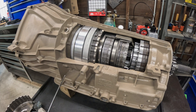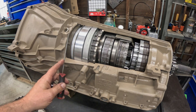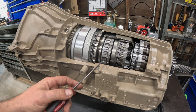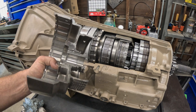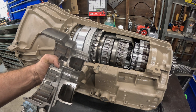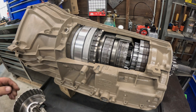There's no magic in here, by the way — I'm not giving away any secrets. This is a fully stock build with used frictions and used steels. The forward drum has stripped splines just like this one does. So I had to actually extend the center shaft an eighth of an inch to engage the unbroken splines that sit all the way at the bottom. That was a fun little thing to do.